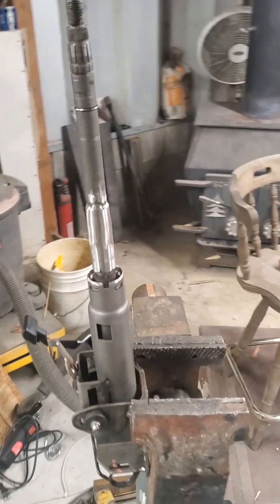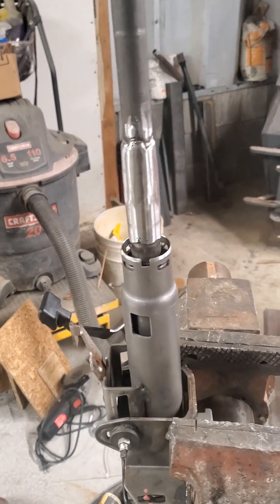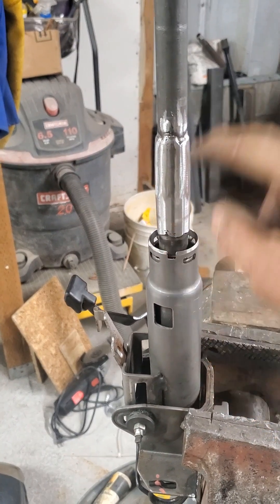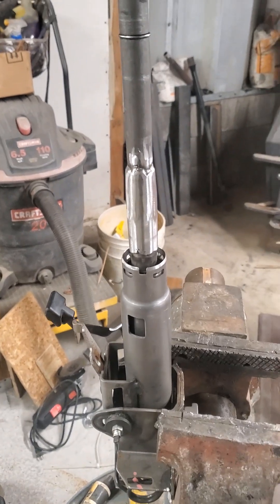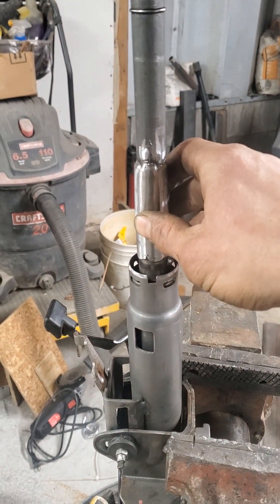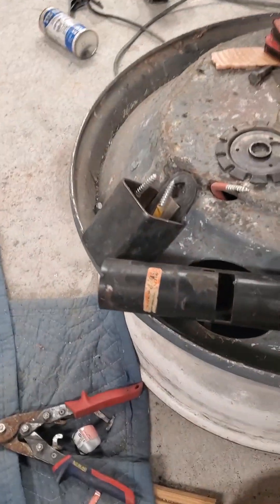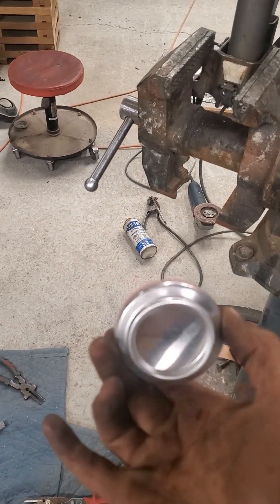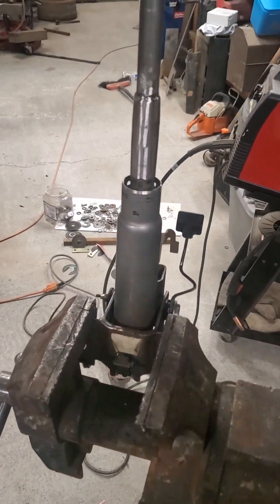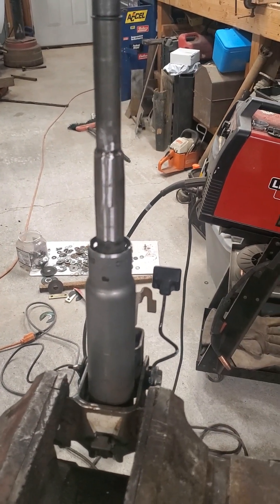This sadly represents way more time than I'd like to admit - it's midnight now, so about four hours. I tried a couple of different ways to get what's left of the Prius shaft and the stub of the Camaro shaft perfectly aligned, and I ended up using a piece of sleeving material. I cut up a soda can because the inside diameters were slightly mismatched, cut strips of soda can and wound them around the shaft to take up the play both top and bottom, and ended up welding it together.